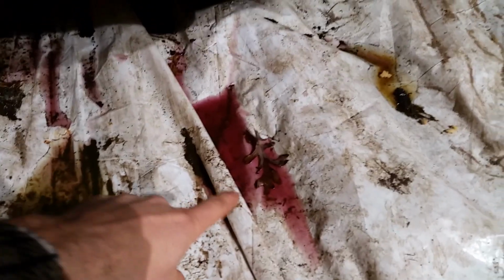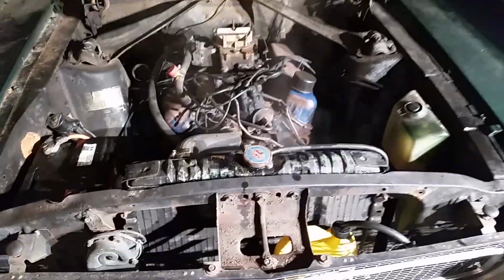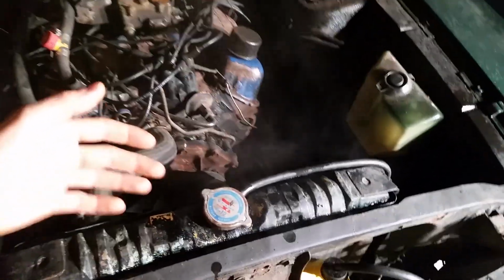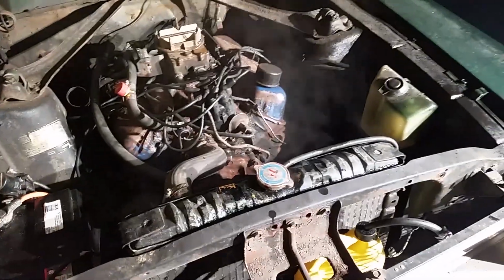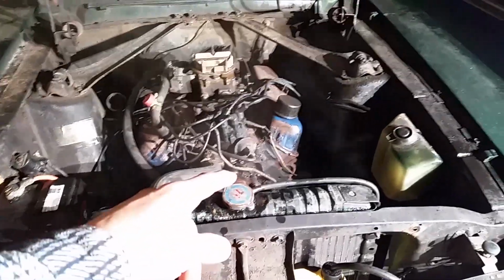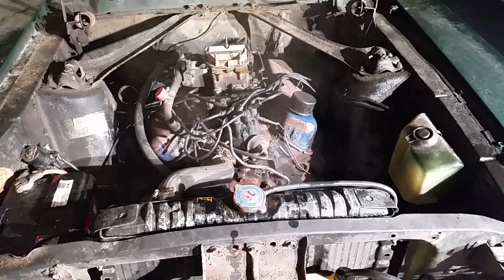The antifreeze burped a couple of times, and you can see here that it's got some of that red fluid rather than the green. We put the green in, so it is circulating through the engine now, which is great. So the thermostat is opening. You can see the smoke here just from all the remnants of it burning off, I guess you would call it. I'm going to look for a radiator right now in the shed. I'm sure I have a couple. Swap it out, put a new one or a used one in, and take it for a drive tomorrow.